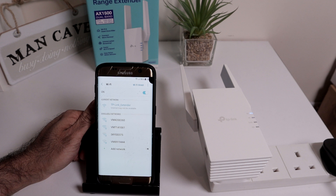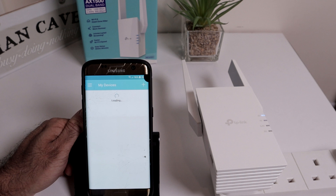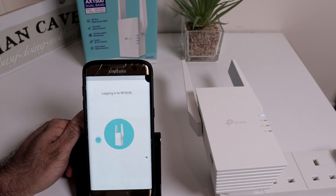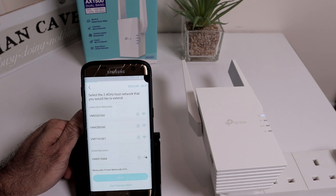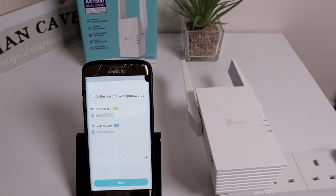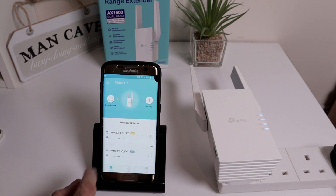Let's get it connected. I've plugged in the TP-Link range extender and the light is solid blue. The network name has come up as TP-Link extender. I open the TP-Link app, which detects the RE505X straight away. I need to create a password — this is just for the app, not for the extender itself. Then I select the 2.4 GHz host network and enter the password for that, then do the same for the 5G. It's now letting me change the name of the extender — it's come up as my existing network name with EXT at the end. We're fully connected. Congratulations, you're all set.